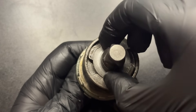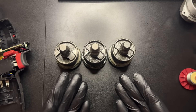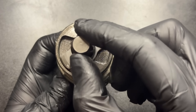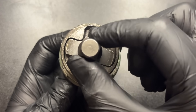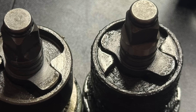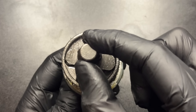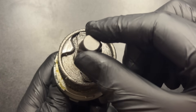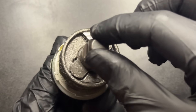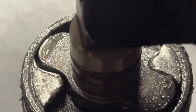But then — wait! Hiding beneath a washer, I finally saw it. On my 2024 impact wrench, the anvil and hammer fit together almost perfectly. On the newer models though, the fit just wasn't right. That's the difference. The machining, or maybe the manufacturing process itself, had changed. And because of that, the hammers and anvils on the newer models don't mate as precisely as they should. That's why one of the tools started off strong and then dropped off — the imperfect fit causes insufficient power transfer, and it gets worse over time. On my 2024 model, the hammer strikes the anvil cleanly every time, delivering consistent power. On the newer ones, the edges just don't meet evenly. One side hits before the other — it's a single hammer hit, not a clean dual strike.